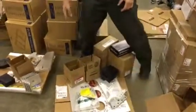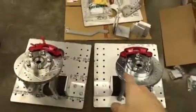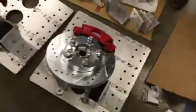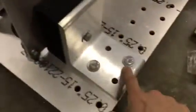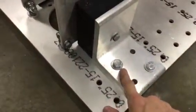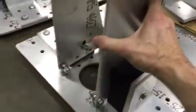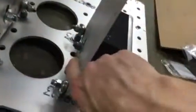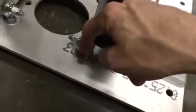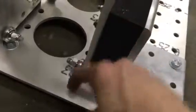Hubert, these are for you. We'll do a clip when it's all together, but this is both the front. Chris, Hubert — when you assemble yours, notice we didn't use all four bolt holes; that's fine. Washers on both sides wherever you have room. Notice there's a washer going through the bushings to hold it in — this is what dampens vibration on the suspension. There's a washer on the back spherical rod end bearings — note the orientation.